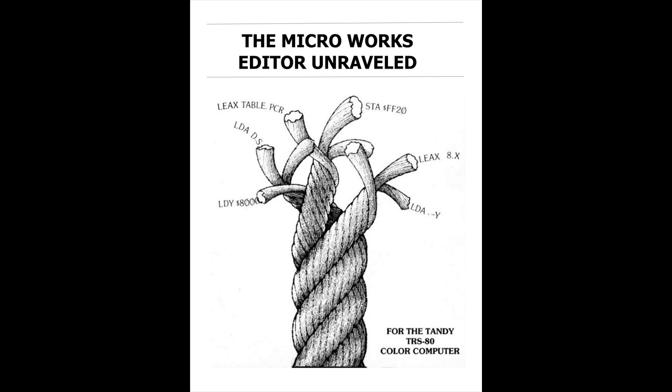You keep mentioning these RAM hooks. Can you remind us what those are? Oh yeah, sorry. These RAM hooks, there are 8 of them, and they basically act like predefined jump instructions to various utility functions within the editor. They're located in memory between 1B63 and 1B78.